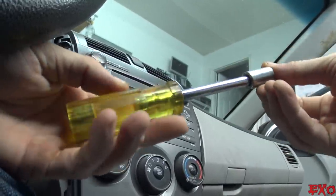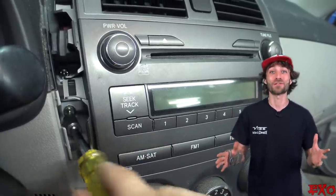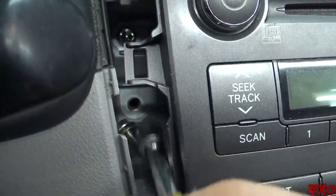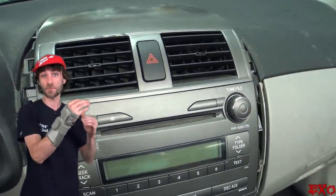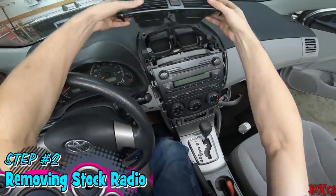This head unit has four bolts holding it in the dash and all of them are 10 millimeters. If you're lucky enough to find the right size in your socket set, bring a little piece of magnet just in case anything slips away. Getting that pesky portion of the air vent just above it removed will give us a clean shot at wiggling the whole thing free.